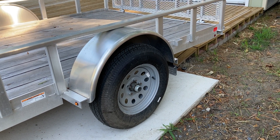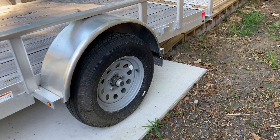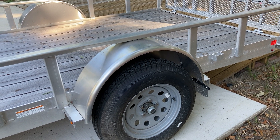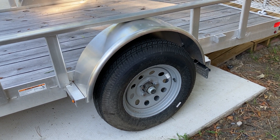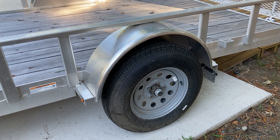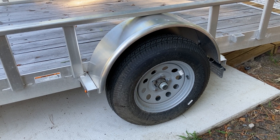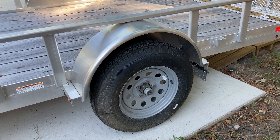Sidewall flexing generates heat over time, and that's where a lot of tire blowouts happen — on the sidewall. Special trailer tires, the ST tires, have reinforced sidewalls to carry those extra loads. You generally don't want to put a light truck tire on a trailer. Nowadays you can also get radial tires — they're a better tire, ride smoother, quieter, and you get better gas mileage.